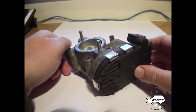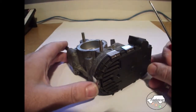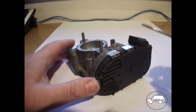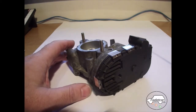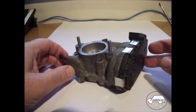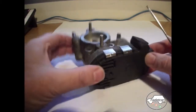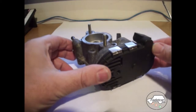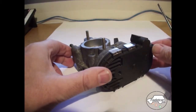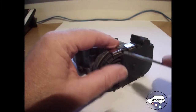Now, you need to be wary with this type of fault. Quite often it is diagnosed as an ECU, which it isn't, and it can also be diagnosed as earthing faults. Quite often people replace earth lugs on the ECU or on the gearbox. That's worth a try because these units are so expensive. This one retails at £280 but is unlikely to solve your problem. So let's take it apart and have a look.